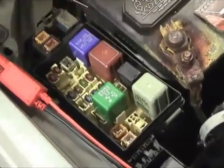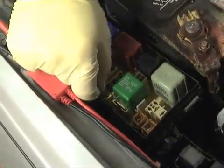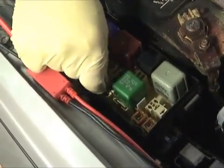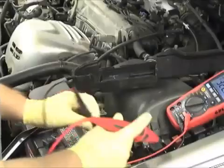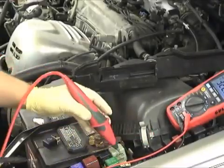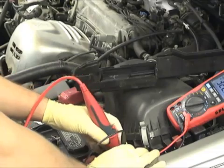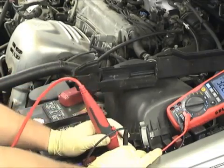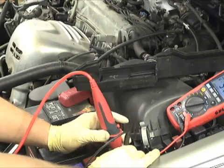Right here is our horn fuse. We're going to put a resistor in its place — 100 ohm — to simulate corrosion in the system. Now, what do you expect with 100 ohms? Our voltage is definitely going to drop a whole lot more. We'll have to wait and see how much it's going to drop, but we're checking it the same way.